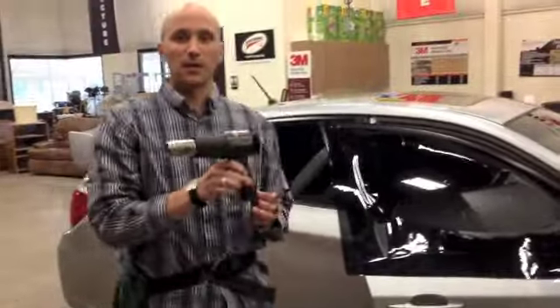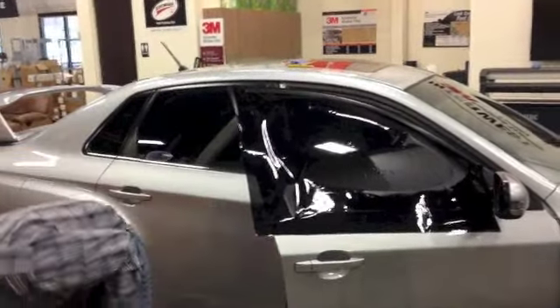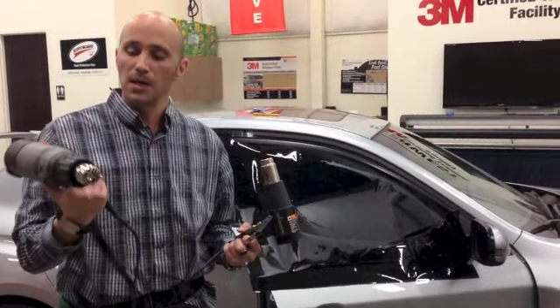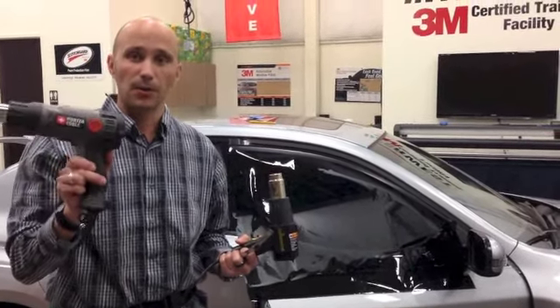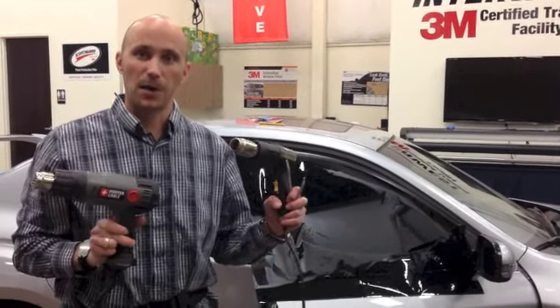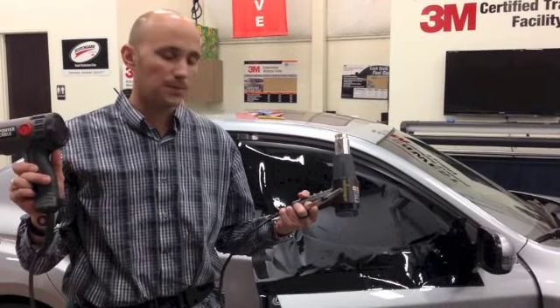The last thing I wanted to share with you guys: heat guns. A lot of people use a paint stripping heat gun, similar to this — not bad — but if you use some of the other heat guns out there, what you want to look for is a higher CFM as far as your air movement goes. These actually function better when you're shrinking and help the film shrink more evenly than getting hot spots with some of your typical paint stripping guns. So that's it for this week, just hope those tips help, and see you in the future.